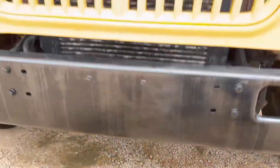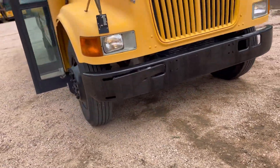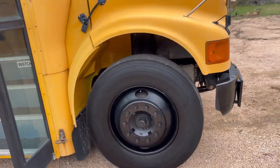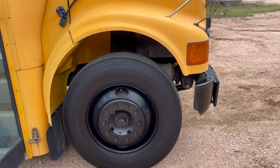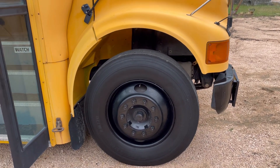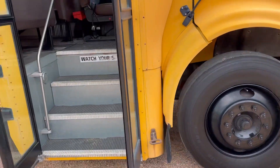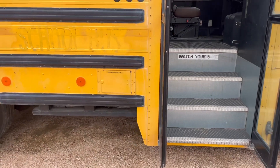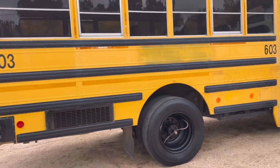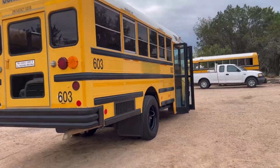The main thing to look for would be dripping. Even if there was a lot of buildup and oily mist caked on the bottom, that doesn't freak me out — that just means it may have had leaks in the past or a really slow leak somewhere. If it's dripping, if there are drips hanging, if it looks wet, then you've got a current issue. This is definitely a very clean engine and it doesn't even look like it's had issues with leaking.